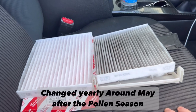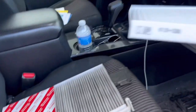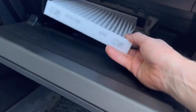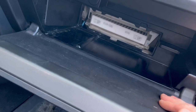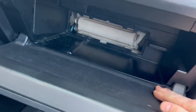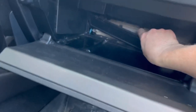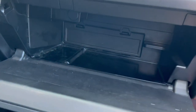This filter is only a year old because I change mine once a year, but as you can see it is definitely dirty. Putting it back is very simple — you see how it says 'UP'? You want to face that towards you, face it up, and finish by reversing everything. Close it up, put your door back by installing the bottom first, and that's that. Put your stuff back in the glove box and you're done.